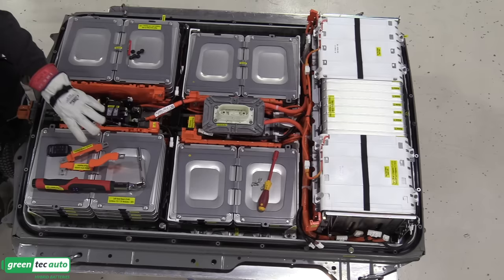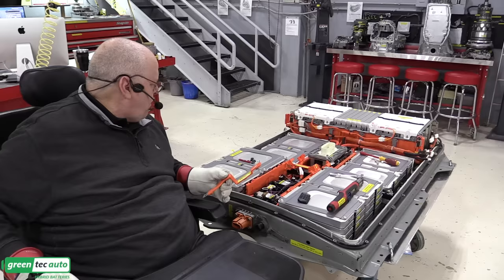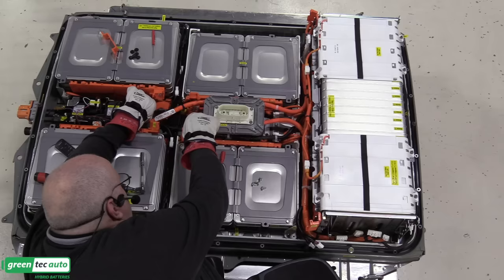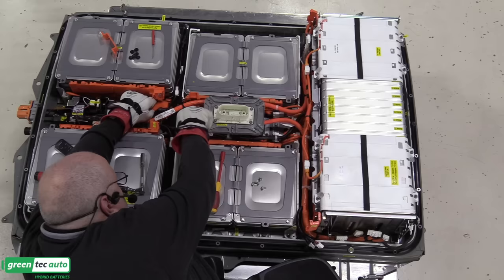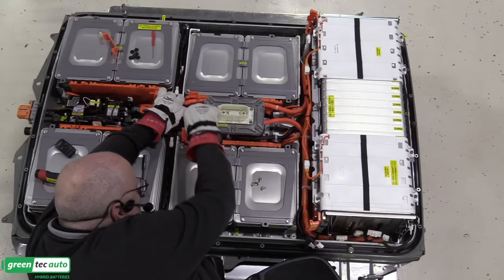Okay, so 36 to 37 right here to right there, and then module 48 to battery negative. So overall battery negative. Looks like I better put it on first. All right, it looks like this bus bar should have gone on before the contactors. Would have made it a lot easier. This is not impossible, but it's less than ideal. There we go. Okay, so there's our negative